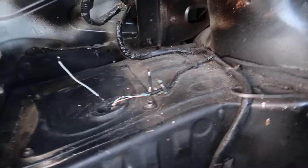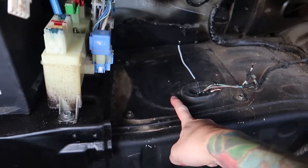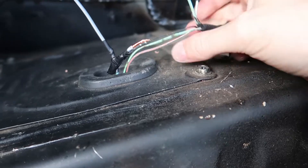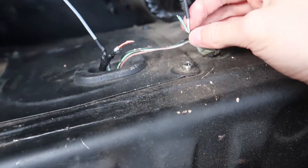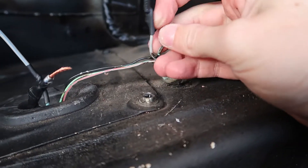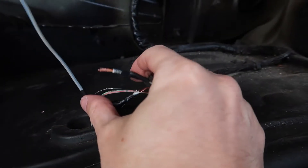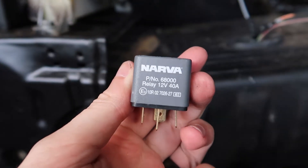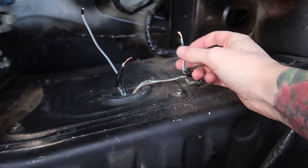This is my boot - I don't have any trim, but you'll need to pull your trim to get access to the fuel pump area. There are five wires here: a grey with a red stripe, green, and black - those three are for the fuel sender which tells your dash gauge how much fuel you have. Then there are two slightly thicker wires: light blue and straight grey. On a Series 1 R33, the grey wire is white. Blue is your positive and grey or white is your negative.